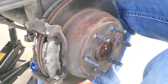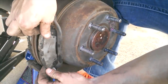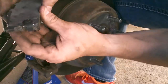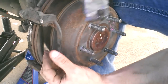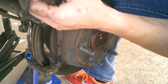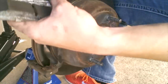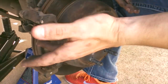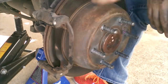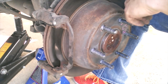If you're just doing brake pads, now that the caliper is off these pads will just slide out to the side. They have two little nipples on each end that fit into grooves on the caliper bracket. Mine are relatively new — I have quite a bit of brake pad left. If you're just changing your brake pads, that's all you need to do: pull the wheel off and two bolts to get the caliper off, and the brake pads slide back in.